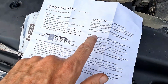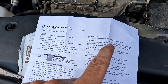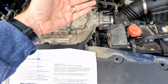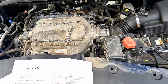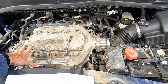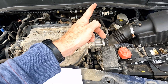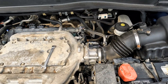One other thing worth mentioning — and another reason I paid for the more expensive unit — is that it has an overheat bypass. Even though it's telling the engine it's not yet at operating temperature to prevent eco mode from engaging, if the engine is actually about to overheat, it will send the real temperature information to your dash so you know you have a problem that needs to be handled.